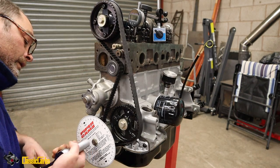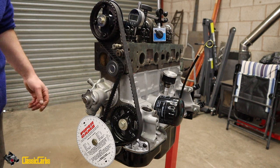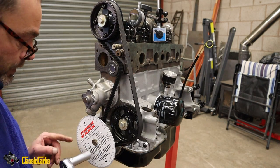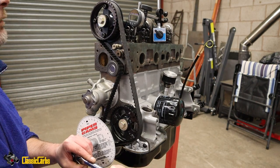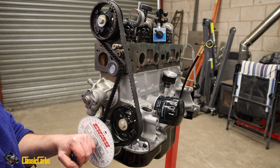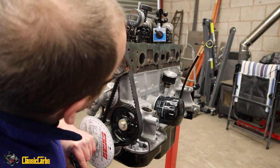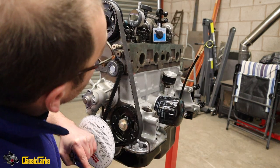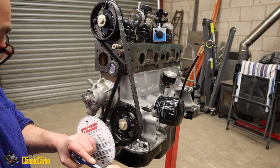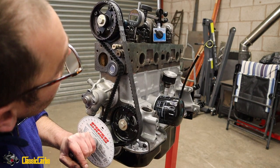Okay, so when I would top dead center, seeing the number one. Okay, that's good. We're back at zero again. Sorry you can't see that. So our TDC, what we want to establish again is full lift, and we're looking for 106 on this thing here. So is the valve opening now? This is definitely not going to work, is it? Why is this not working? Okay, so now it's working. Exhaust valve usually fully open. So inlet valve's opening now. That's full open. 10.7.